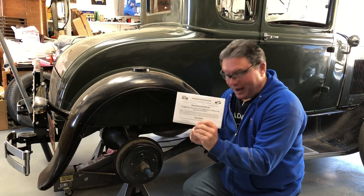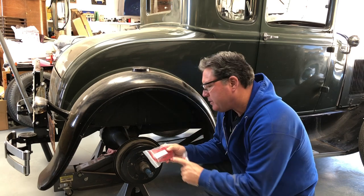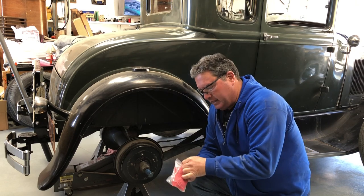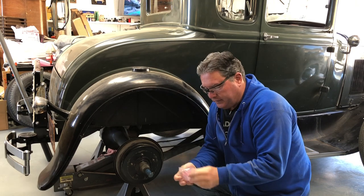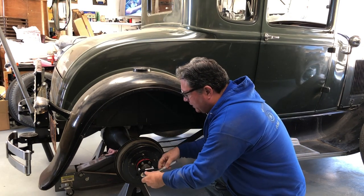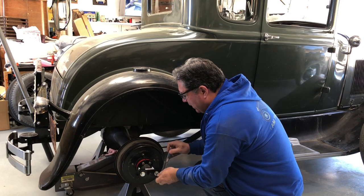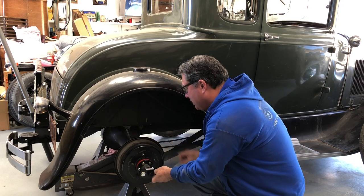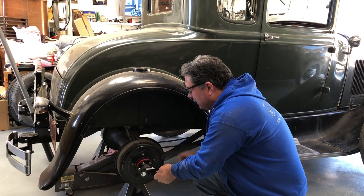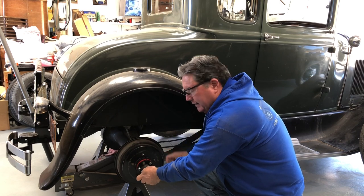Instructions — put those aside. I've got parts here. This is the split rings for the early hub and split rings for the late hub. This is an early hub, so let's put this together and get this hub off. I've got the Mitchell Manufacturing rear hub puller all assembled and installed on this rear hub. It did include a little nub on here, so you still give it a good whack because in order to break that seal between the hub and the axle — it's a tapered fit — you need some kind of shock.